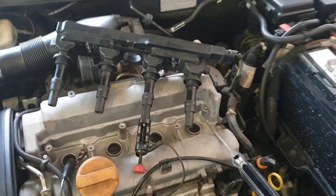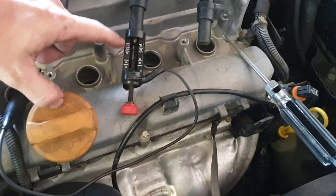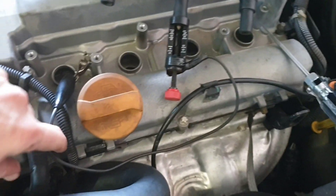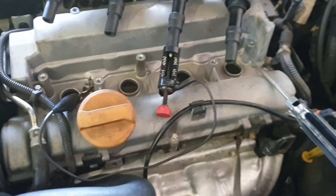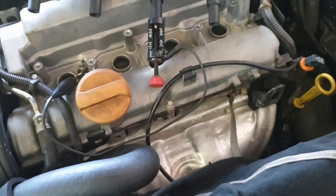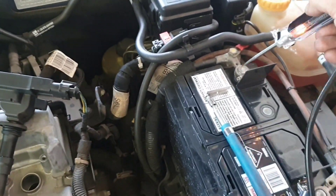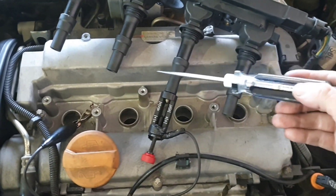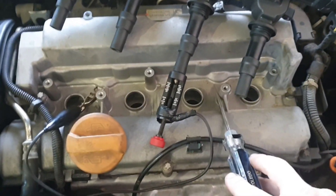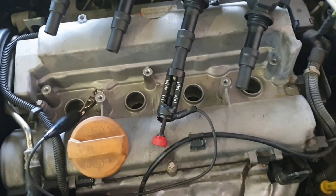So this physical test of the coil — I've got just a spark tester. The numbers represent kilovolts and the spark's going to jump across there. Obviously I've got that going to earth so that there's somewhere for the spark to travel. I keep a grounded lead, or in my case I like to use a test light. The test light is connected to ground — if I put it on a positive it lights up. We're going to be able to use that to run along the coil, and if there's any insulation problems it's going to jump to ground through there as opposed to having to jump across here which represents the spark plug.